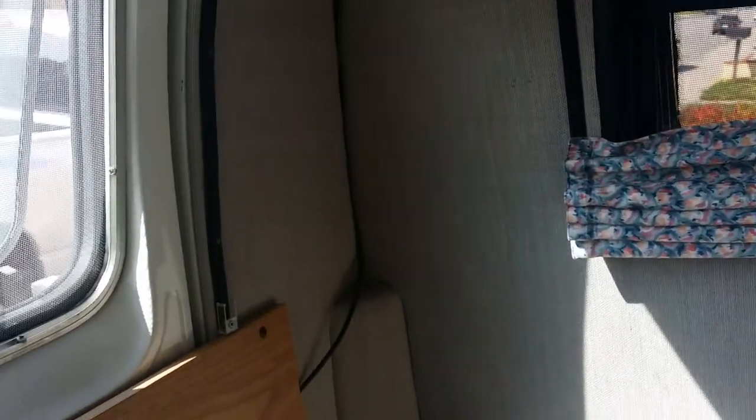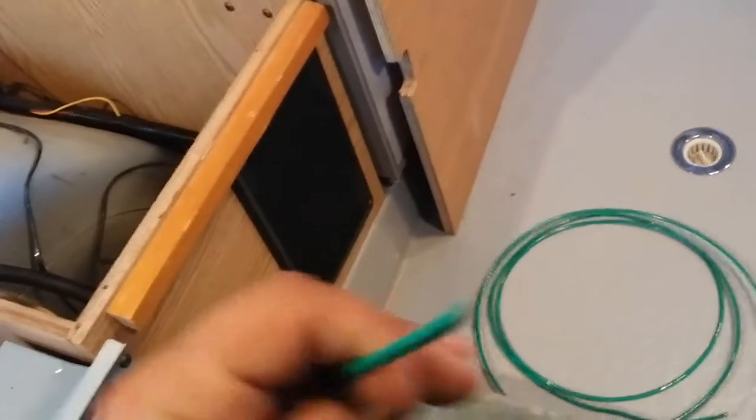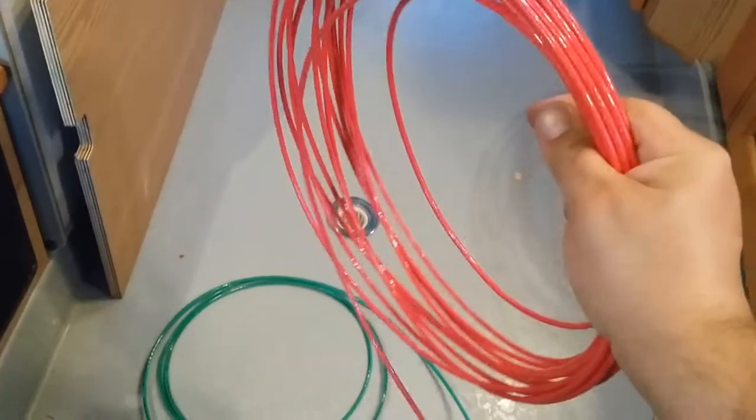For now I have the antenna going underneath here, coming through the rubber weather stripping in the door, up along the edge, and to the top. I was able to bring the cable through a couple of holes drilled through the bottom. I pulled the antenna cable through there, and I've got some 10-gauge stranded wire — a ground line and 40 feet of red. One circuit will be here and another will run up through this panel, over the metal beam that holds the air conditioner, and then behind the paneling behind the shower to a workstation on that wall.